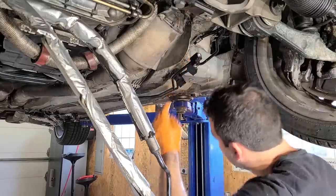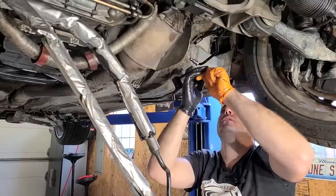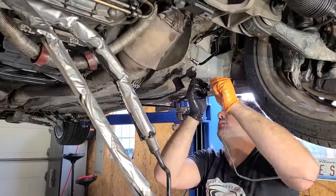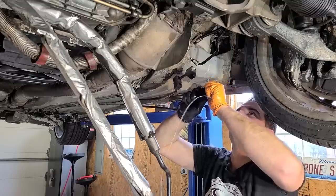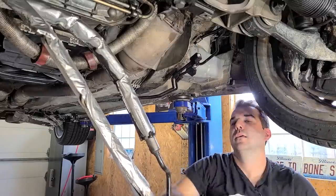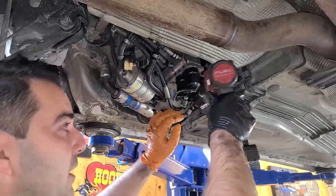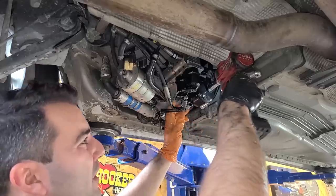No restriction — we're probably about halfway down the line right now. I don't see any remnants of anything, no black rubber, nothing. I have enough here to cover the entire metal line and it'll reach past the rubber ones if I wanted. It's a little difficult because we're not dealing with the strongest piece of wire in the world. I'm not having any luck at all rodding this line out — it seems free, feels like I'm getting it all the way to the back.